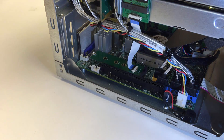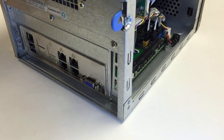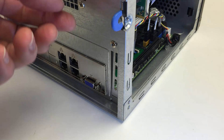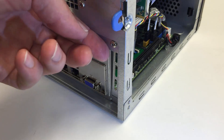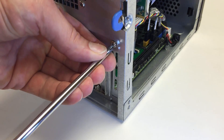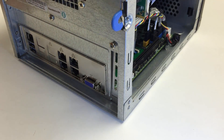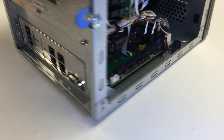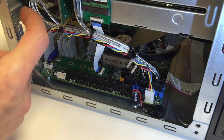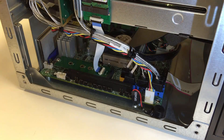Now, with that freed up and taking anti-static precautions with the GPU — it's fairly humid where I am right now, so I'm not too worried about that. What I'm showing back here is that this screw, if you back that out a few turns but leave it in place, we now have that screw no longer protruding right where we're trying to work as we want to lower the PCI card into place.